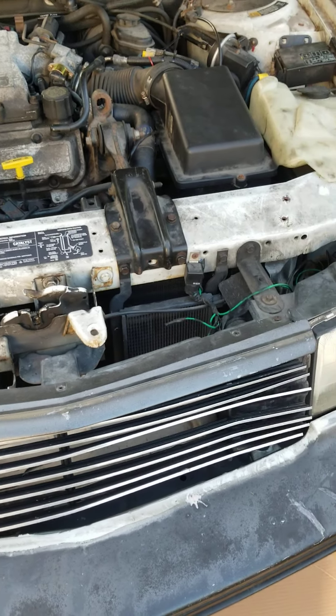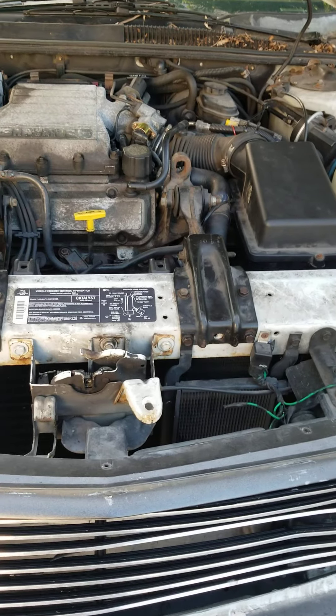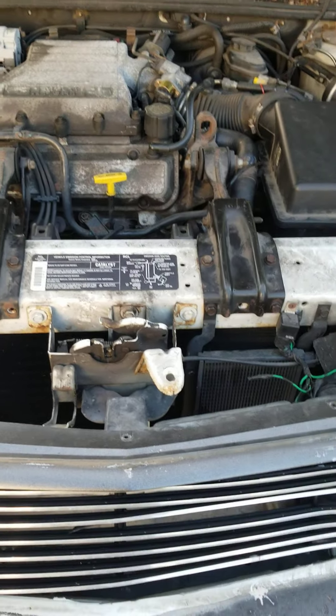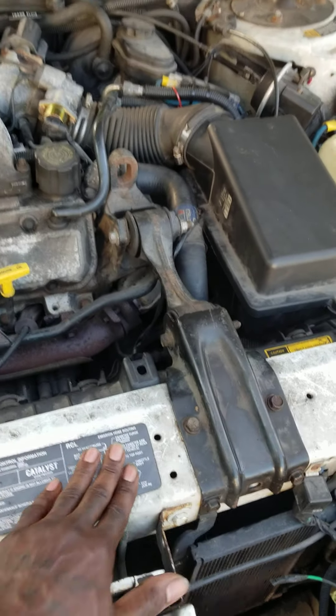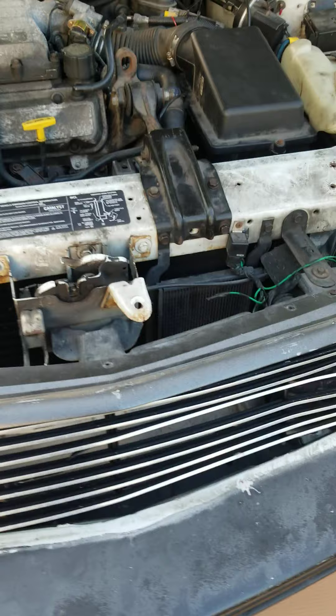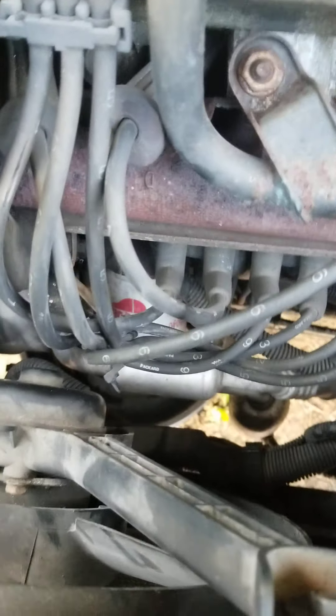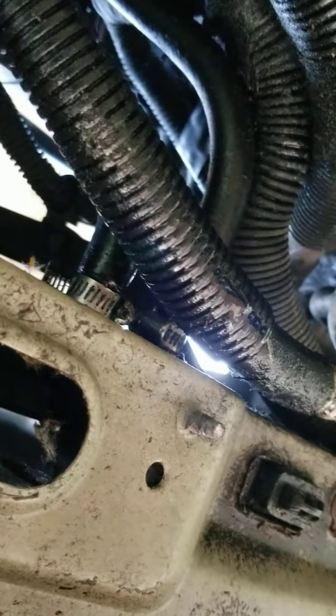This is a built-with-that workshop. Today I'm gonna show you how to do an oil change on a 1990 Chevy Lumina. The main thing is you're gonna locate your oil filter. I'm locating my oil filter — that'd be the one with the CarQuest logo on it right there. Then we're gonna go under the vehicle.